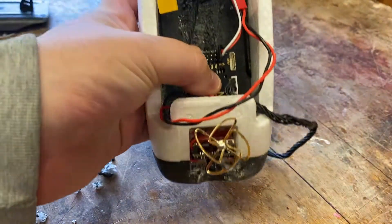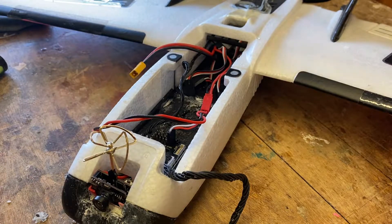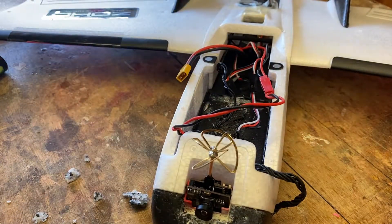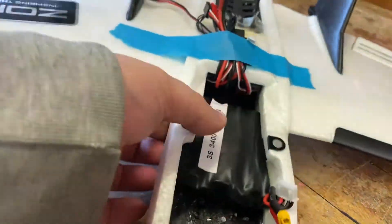What's amazing is I seem to be able to stick it back down with the same stuff and it's fine — it's now not moving. That's fairly incredible. The GPS cable is long enough. We need to look at extending the elevons and the throttle. It actually isn't going to take as long as I thought. I'll try and find three shortish extension leads and we can then get that wired up. Progress has been made.